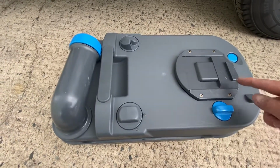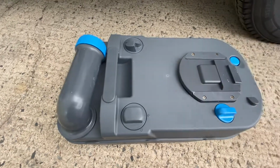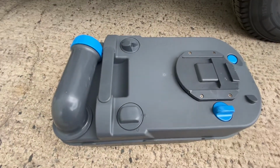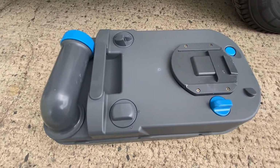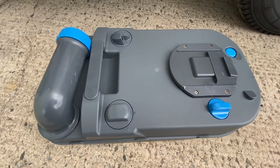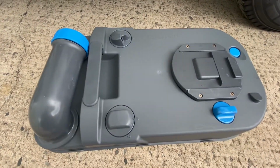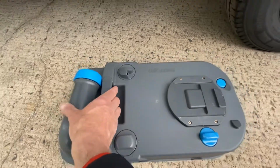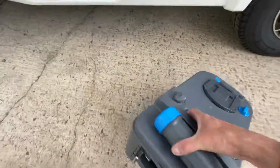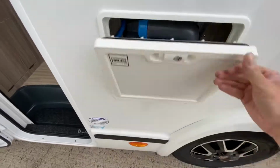If you want to wash it, you can slide the slider open on it and then open the actual compartment door there to let you down in if you want to wash it. Priming up again, a couple of glugs of the chemical. You get to know what you like, if you like it a wee bit stronger or whatever, and I usually prime it up with like half a pint of water just in case there's any solids go in there. They should be covered by the chemical and start to break them down. So whenever it's primed up again, keep it primed up all the time whenever you're not using it. Give it a good slosh around, lift it back in again and just slide it straight into this compartment. Lock the door again.